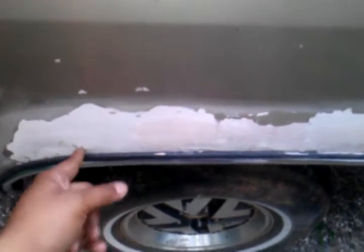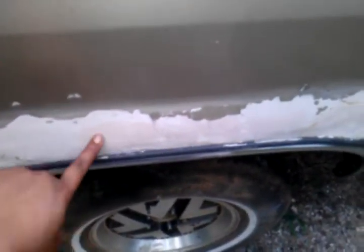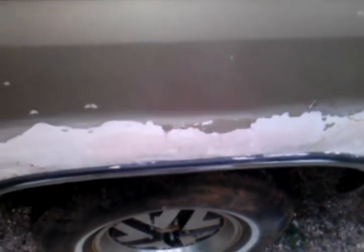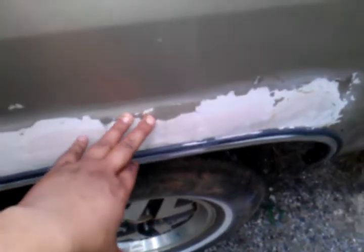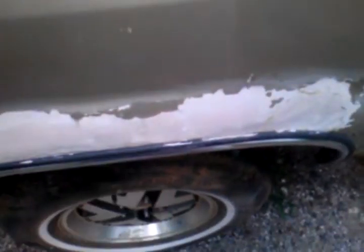This is a 1990 Ford Ranger XLT standard cab. I've done some bodywork on it a couple months ago. This here is the Bondo Auto Body Filler from Kmart — I think it's around $25. What you do is mix the red with the white, make sure it's mixed thoroughly, put it on wax paper, and then lay it across wherever you need it. It sticks and starts drying, then you peel the wax paper off and sand it down a little bit.